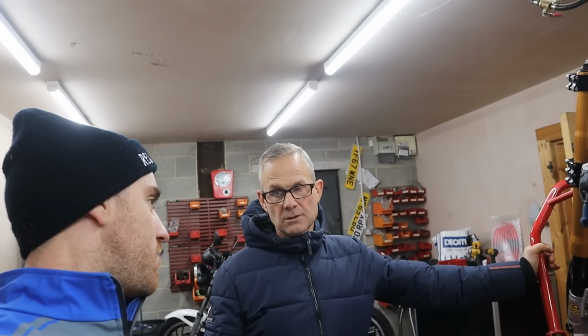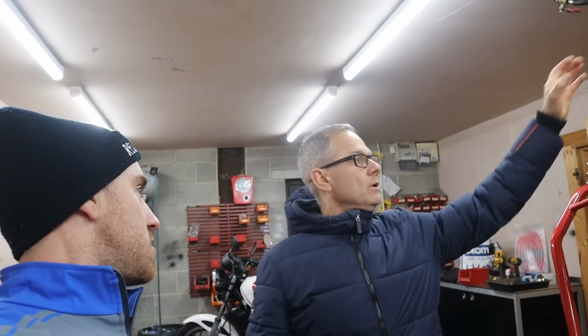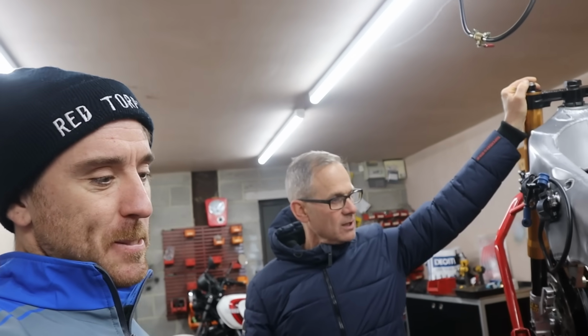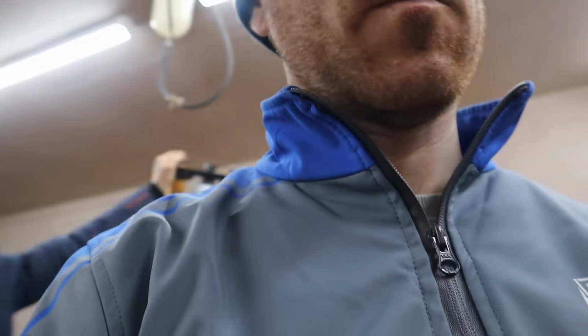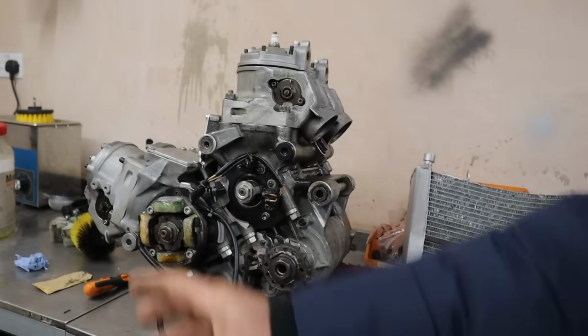But if we're going to try and get it running, you would rather rebuild it. So basically we can't take it apart, even if we're not going to do anything, because we haven't got seals. Put it back together again. Clyde Padgett will have everything we need to rebuild it. However, he runs one, and when these things are running out, you don't want to give a spare away anymore, mate. They don't make any more, so he might need them, and he's a bit careful with them, which you can understand. And he's from Yorkshire. But if we could get gaskets, bearings, seals, all that, I'd love to get into that. And new studs, vapour blast everything, and it just goes like new.